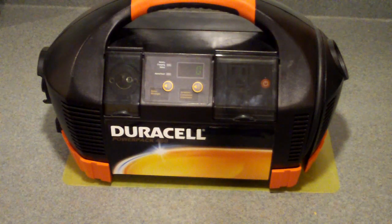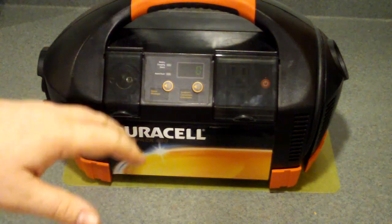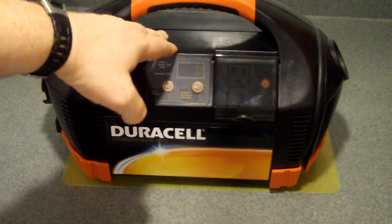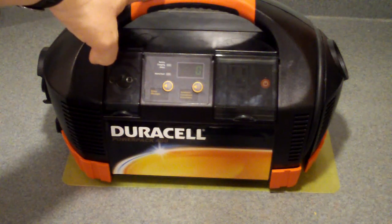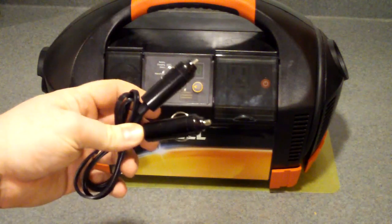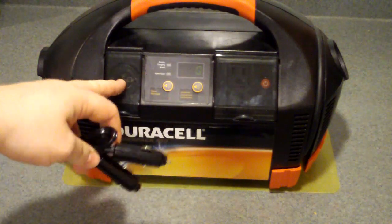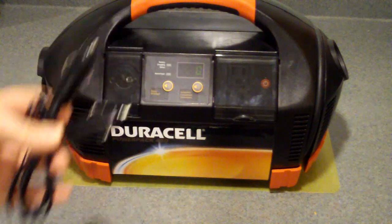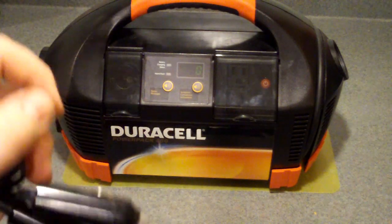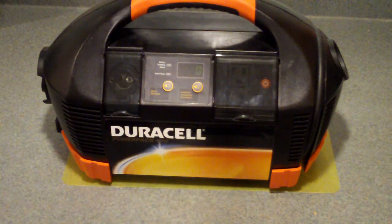That's a couple days of direct sunlight, and I'd have power. Now the trickle charge on here, you can leave this plugged into your house, and it'll sort of trickle charge, and it took 2 days on your house power to recharge this thing when I first got it. Now it'll directly charge off your car and go car to car in 3 hours, and that's just the nature of that back AC plug they have, a slow trickle charge, which is better for the battery.